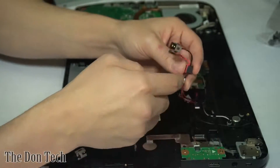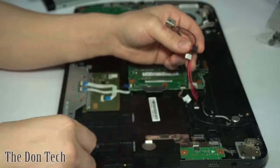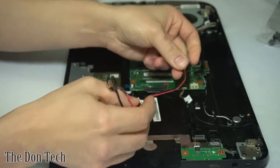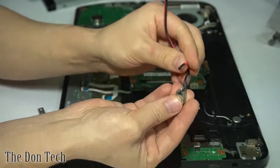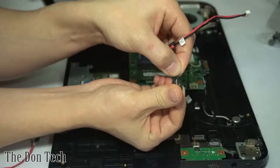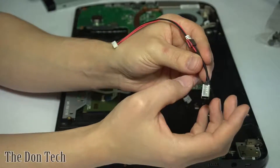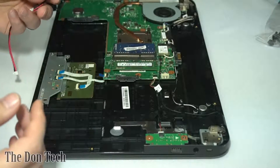It's not screwed in at all. There's a little bit of double-sided tape that was on this little metal piece, but that wasn't sticky at all. I have a replacement one that will hopefully be sticky. It disconnects here from the port on the motherboard — carefully pull it out, do not pull it up. And there you go, you've taken the DC jack out, nice and simple. Here you can see this wire was actually supposed to be connected in and it's not, so that's going to prevent the DC jack from working. The brand new one is connected nicely and neatly.